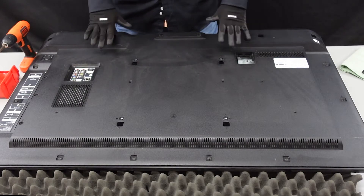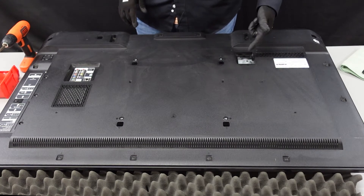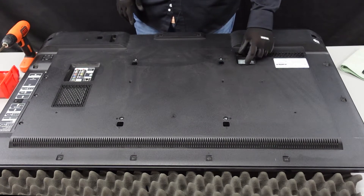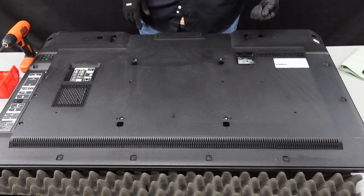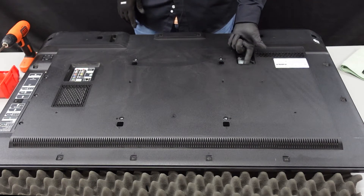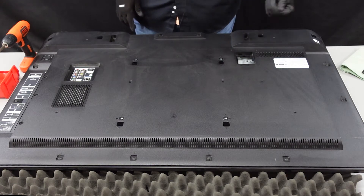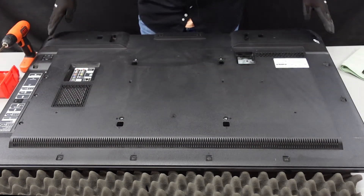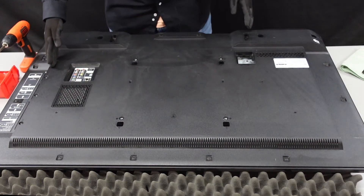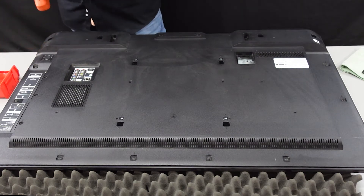This is the back of this Sony unit. There will be a small plastic cover here — one screw comes out of it and you should be able to slide the plastic panel off of the cord that goes to the wall socket. Then there is just one clip on the power supply board; use your thumb to clip down on it and it comes right out. After that, get all the screws around the outside taken off as well as the screws lining the main board, and we should be able to lift this back up and away from the chassis.